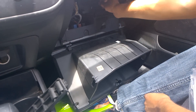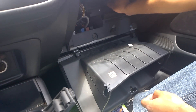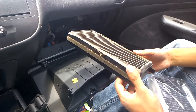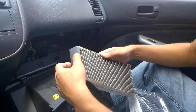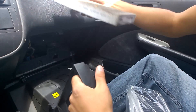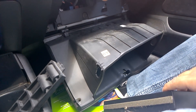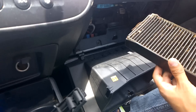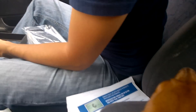There is a little door right here and what you have to do is just pull it out. As you can see, this is very dirty, which explains why this car stinks. Just pull it out of there and throw that out. There's another one in here — you have to slide the box and pull it out again, and there's another really dirty air filter. This air conditioner is probably working very hard to cope with these.